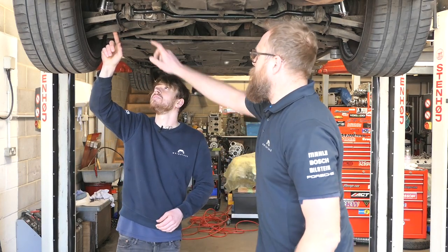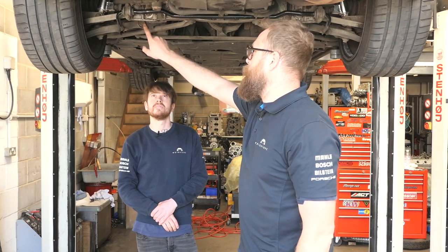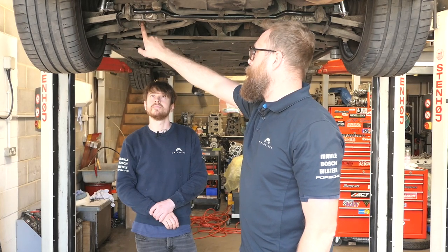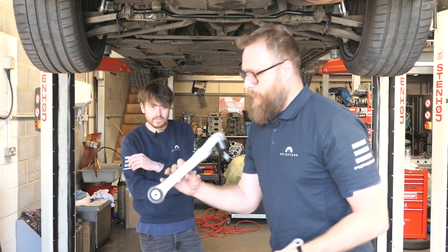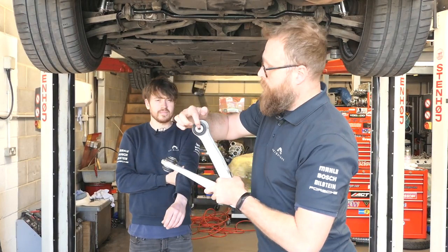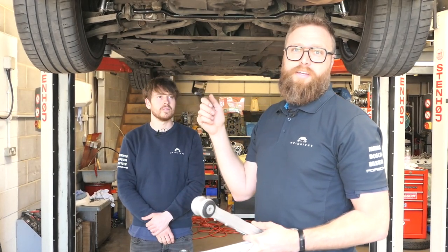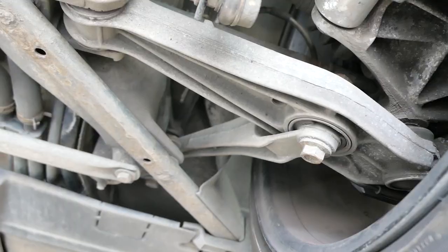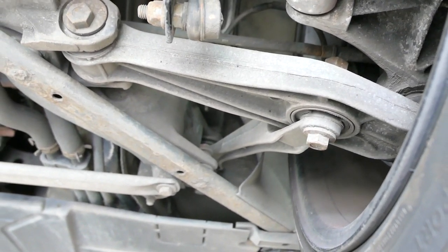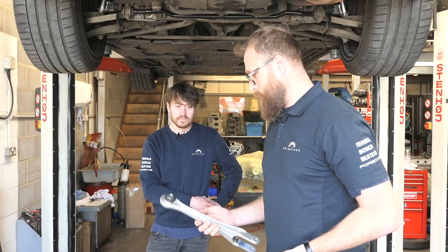That's the thing we have quite a lot of trouble with sometimes. It's an eccentric bolt — we turn that and adjust the geometry. But there's an alloy bush. That bush there is aluminium and this bolt is steel, and obviously they react with each other. So sometimes what should be undoing a nut and throwing it out takes an hour. To do a couple of arms, it can take an afternoon. This is what we change all the time — we keep them in stock, loads of them.